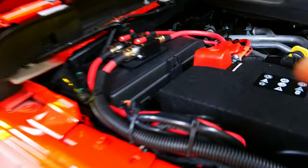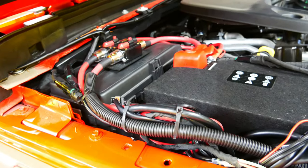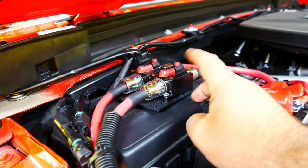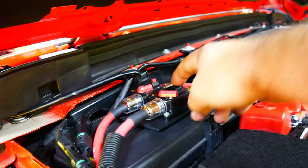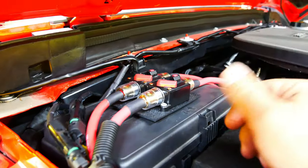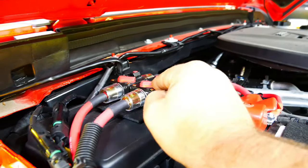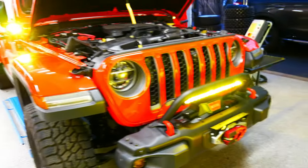There you have it — the wiring for all of the accessories. I've tied in all the lights to the auxiliary panel that comes in my Gladiator. I've put in these 500-amp trip breakers — one is for the front winch and one is for the rear winch. I'll probably leave them both off just in case there is some power cable chafing so nothing shorts out. I like these because they are resettable — I don't have to carry fuses around. Everything I use to build my Gladiator is in the description below.